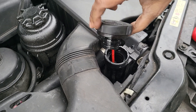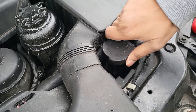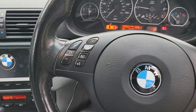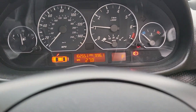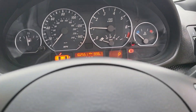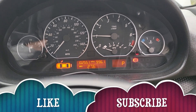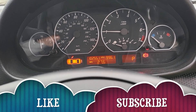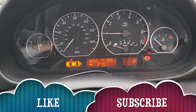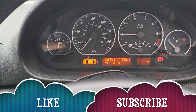Once that's done, pop the cap back on and let the engine run to make sure there are no other air pockets. Keep your eye on the temperature gauge — it needs to stay bang in the middle. I've got the engine running now. You can press a couple of keys to get the actual temperature readout. Take it for a quick little drive, a mile or two, to make sure everything's flowing. If it starts to overheat there's probably still an air pocket and you'll need to re-bleed it. Any questions, hit me on the channel — thanks for watching, like the video, sub the channel, and I'll catch you guys in the next one. Peace out.